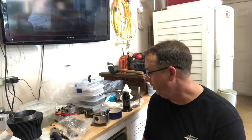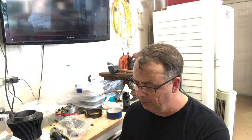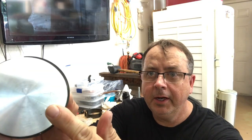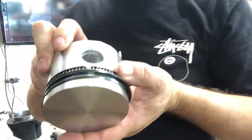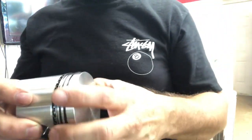All right, guys, it's a new one for me. I've never done it before. When I bought my pistons, they came with the rings already installed on them. But you want to make sure the rings actually say top on them, the one that goes pointing up. I just want to verify that it actually says on this edge here that it's top. There's also an arrow on it. I don't know if you can see that arrow there or not, but it points towards the flywheel. So that's very important. All right, can you see that? Let's get it pointing towards our flywheel. Okay.